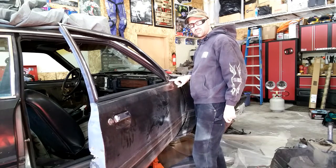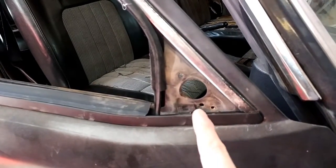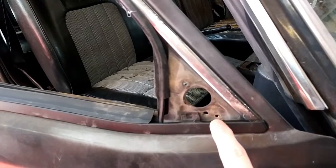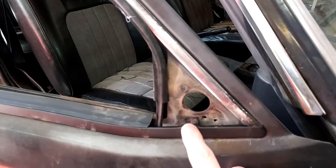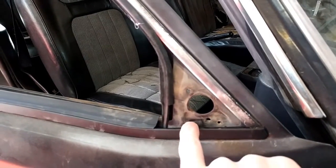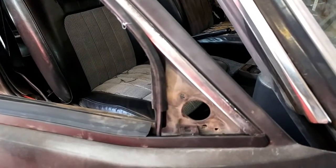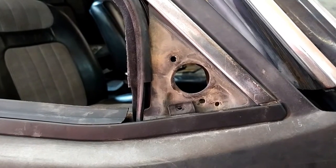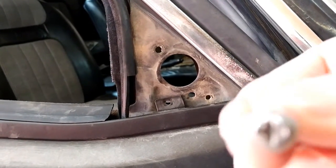On the front, let me show you a little more detail on how this front fits. Here's the front — you can see this is where the mirror goes in, and these two holes are what the mirror studs go through. On your new piece, this hole is what the factory used to attach the window molding to the door. But if you notice, there's not a hole, so I'm going to have to tap this — basically put a hole in here for the screw to go in. I'll put a mark with a paint marker just touching through the hole so I know where it is, take this back off, drill the hole with a 5/32nd drill bit, and then put it back on and fasten it in. Just take your time and be patient — it's not very thick metal and it'll go right through.